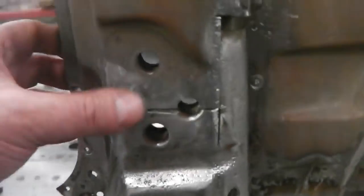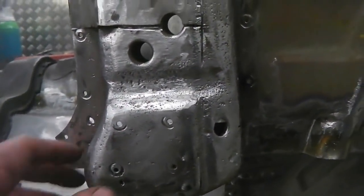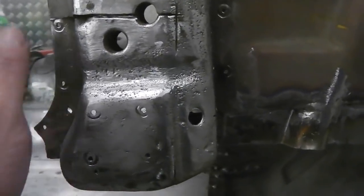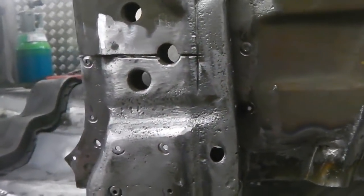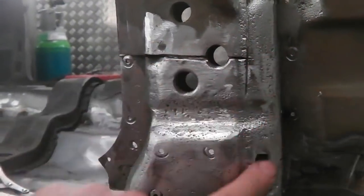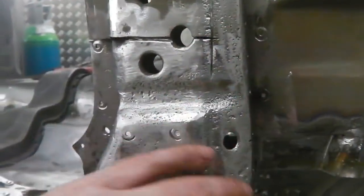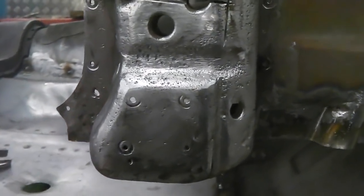Cleaned and ready for the weld through. We've got to do the whole thing in weld through because of the heat that's going to be generated, there's no point doing much more. The weld through is zinc based and zinc rich. It's rust proofing as well, so we'll give it a generous coat of this, because there's going to be a lot of heat from them welds along the side. So, weld through primer on this next to get it ready for the welding job. And then we'll stamp out.